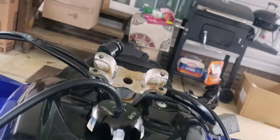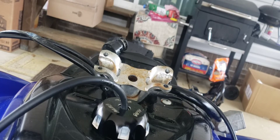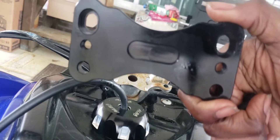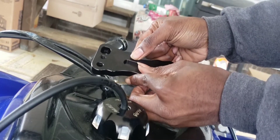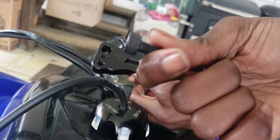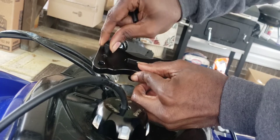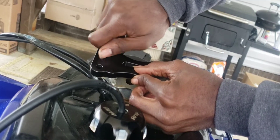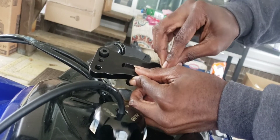I got the handlebar off, got the clutches, throttle, and everything unbolted from the old handlebar. I'm gonna start putting the handlebar clamp on itself. The first piece that you need is gonna be this piece right here — we're just gonna sit this on. You got two allen screws that come with it. Screw that down, then tighten it down with an allen wrench.